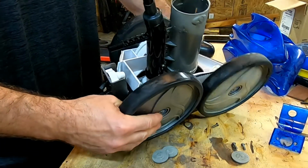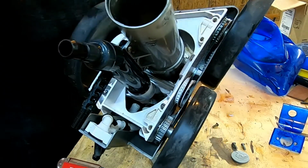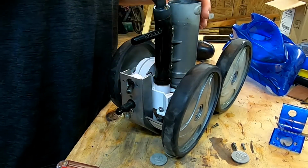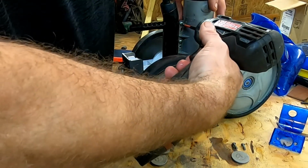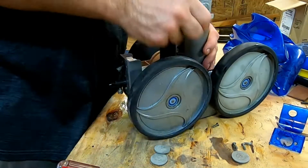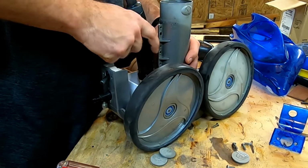All right. So there's one screw there, 1, 2, 3, and 4. Take those out and then that will drop the bottom out. Now in order to get this whole thing out here, you need to drop the actual spout, which is just 3 little screws right here on top. There you go. All right, once you get the screws out, this should just come right out.